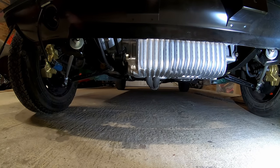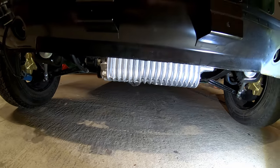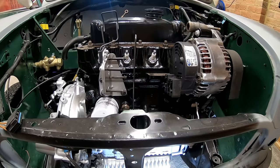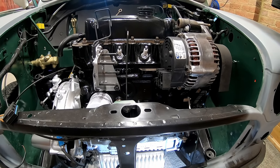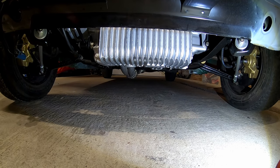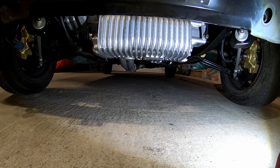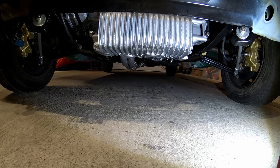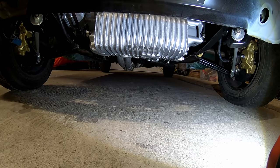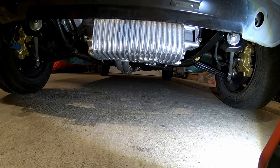All the underside is back together now. The exhaust front pipe — I had mentioned in previous videos about fitting an LCB, but I'm not going to do that, not at this stage, because LCBs are about £140 now so they're expensive. The exhaust I got for this is a pattern part, new though — it cost £26, which might have even included postage, which is just phenomenal. It fitted okay. The welds on the flange between the exhaust manifold and downpipe were really messy and too big, restricting the flow a bit, so I just used the die grinder to grind them out and match them to the exhaust manifold. It'll probably make about 0.01 brake horsepower difference, but it gives me satisfaction that it's made a bit better.